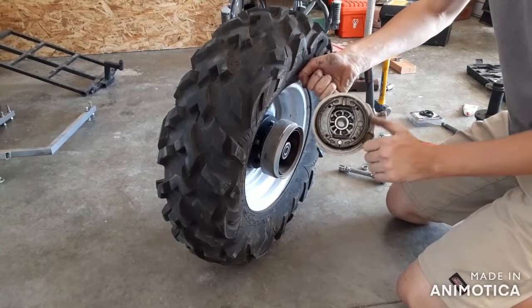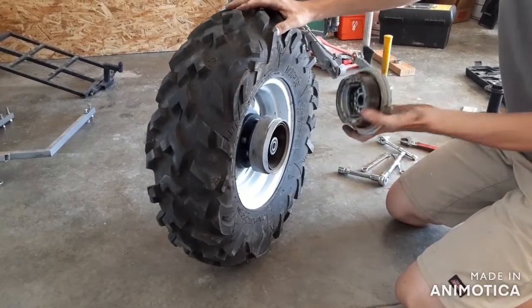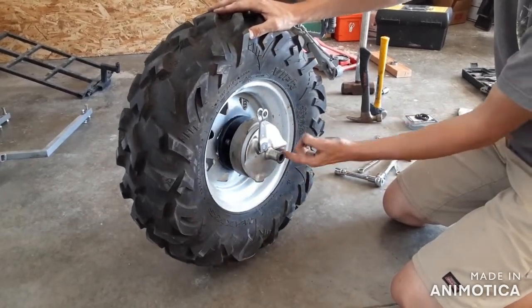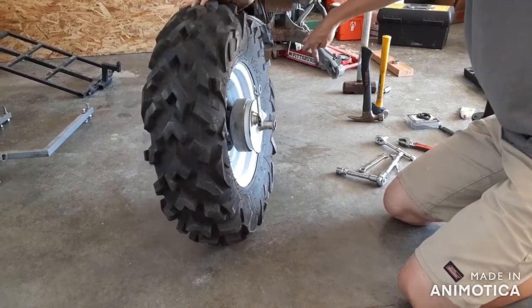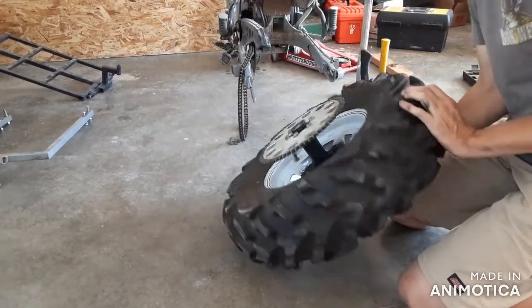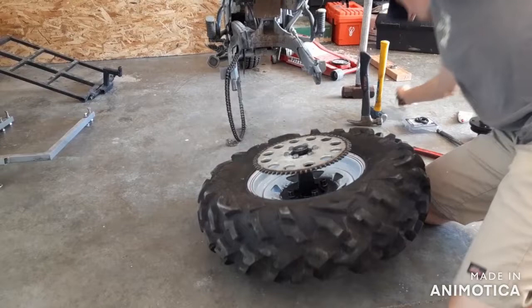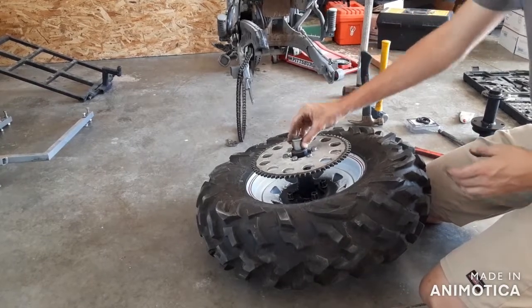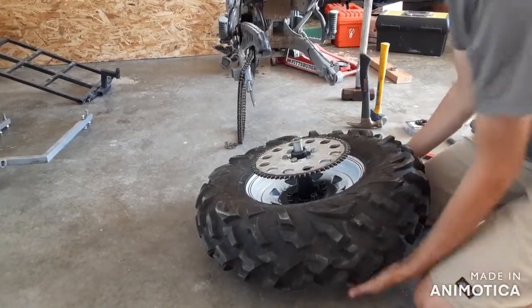While you have your brakes off, inspect your brake pads and make sure you're not going to need new ones. Most of the time they're fine — most people don't use it all that often — so the brake just slides on. When it goes to slide onto your swingarm, make sure it is lined up straight forward and slides onto this little catch piece here. On the far side, your seal and this piece ultimately go right here — slide into that. If you use that seal, it will kind of hold things in place when you're putting the whole thing together.